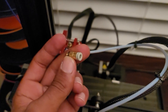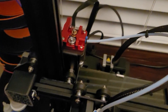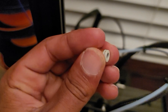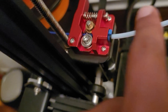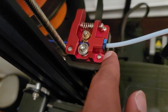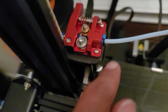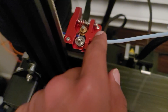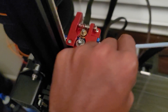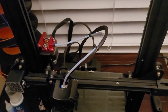The last part is to take out the fitting — squeeze it and pull out that inner piece. Always remember to first take out the blue inner piece. Then there's a black part that comes with the kit. Slide that into the red part first, then once slid in, take the tubing and feed it completely in. Use the blue ring — you'll likely already have this on your Creality, but it also comes in the kit. By putting that in, it's completely locked in place no matter how much you try to move it. And that's it — now you can print away.